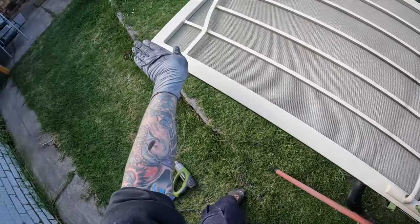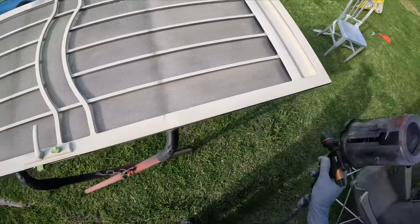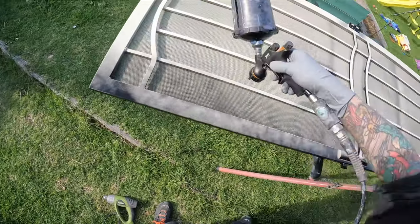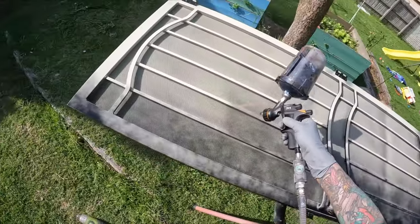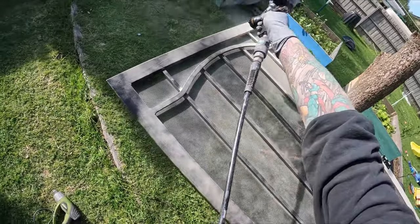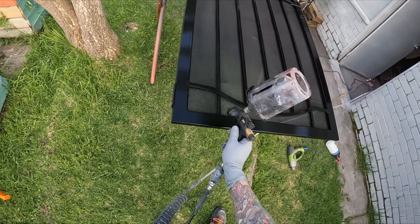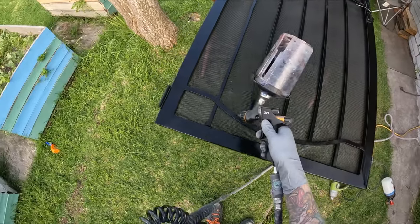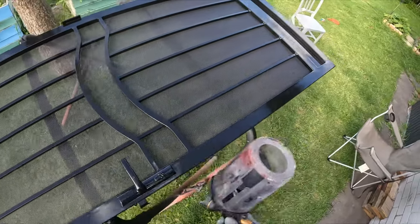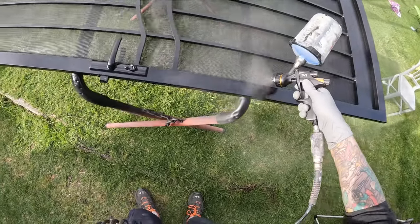There are lots of different angles that we're going to try and get, so that's why I use the push method — you push it like that so you get those angles on that pass and these angles on the other pass. It turns out that my mate actually sprayed some silicon, which is definitely not a good thing before you put your paint on. I noticed it — I could feel some sort of oily thing on there, and I did try cleaning as much of it off as I could. That's actually why I'm putting this first coat on medium, not too heavy. Those with a keen eye may have noticed it was fish-eyeing up a little bit, but lucky that it's water-based paint because it doesn't seem to react with the silicon anywhere near as much — solvent-based paint would have been somewhat of a nightmare and fish-eyed up badly.